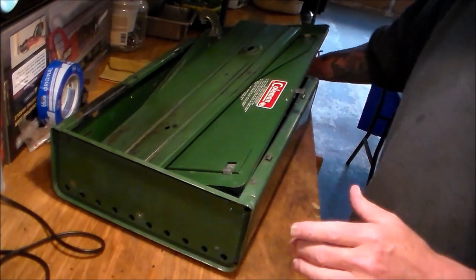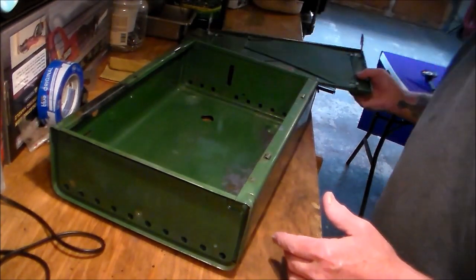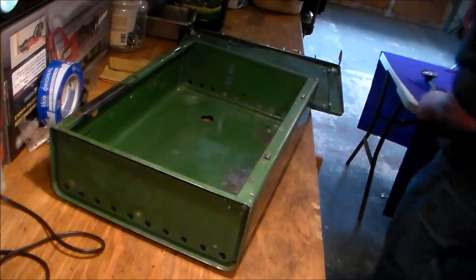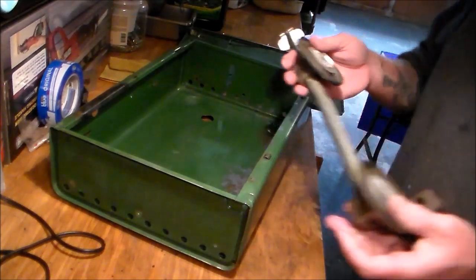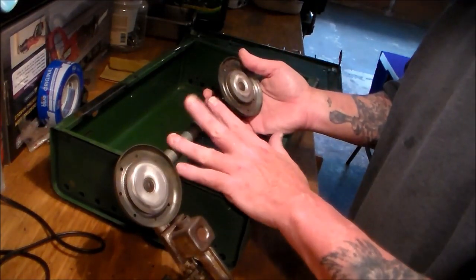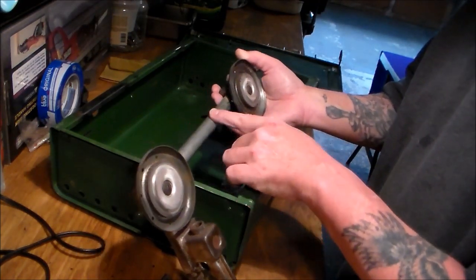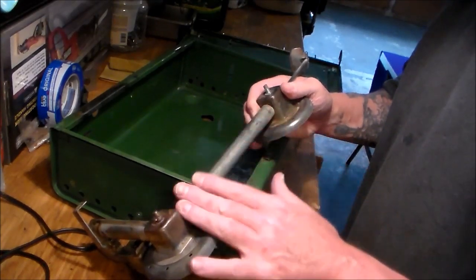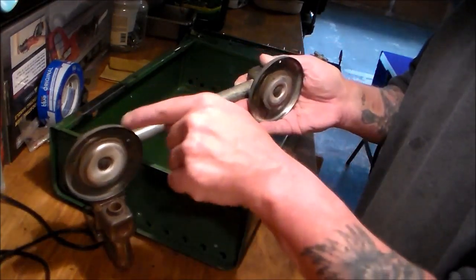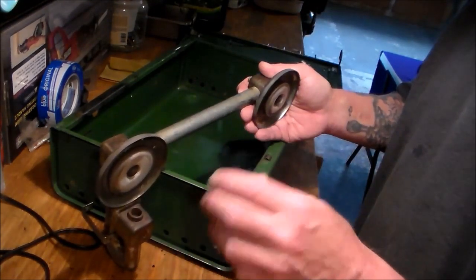Before we do that, though, let me give you a couple of things that I forgot to tell you earlier. First off, the fuel or the burner assembly. This does not go in the washer. You don't scrub this down with water. Reason why, this is very thin galvanizing, and it will rust really easily. So if you get water inside of this assembly, no matter how much air you blow through it, you're not going to get it completely dry.